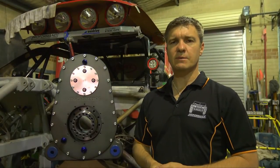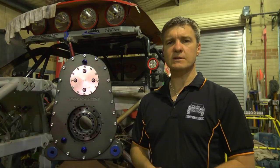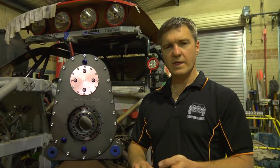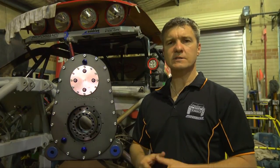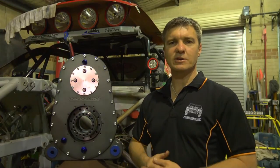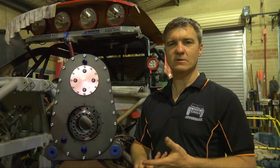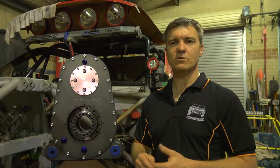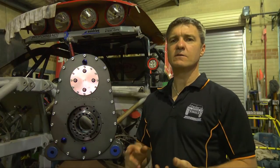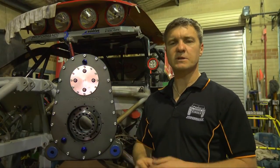All of the components we design and manufacture at Proformance have been designed with one thing in mind — racing. When you're racing you need to be able to service our components in a very short amount of time between stages or should something go wrong. Our components have been designed to be serviced in the field without special presses, without special tools, without any gaskets and sealers, without any glues. The idea is these components can be hand assembled and hand stripped and put back together. Working on a gearbox or a transfer case in the middle of nowhere generally results in oil everywhere and a bit of a mess — it's pretty hard to get gaskets and silicones to seal without having it completely stripped and perfectly clean like you would in a workshop. All of our components have been designed with O-ring seals on the faces and O-ring seals in all of the bores, thus preventing the need for gaskets, sealers and silicones in the field. Pull it apart, do what you need to do, clean the O-rings, put them back together — in a matter of minutes you're back on the track again.